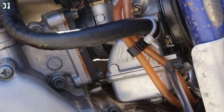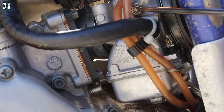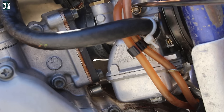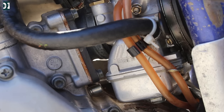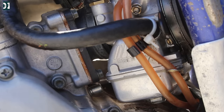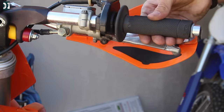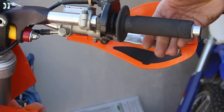On the YZ125, right here is your air screw, and this is your idle adjustment. You need to loosen this nut first, then with a Phillips screwdriver you can move it in and out — it's a very fine thread, so it makes small adjustments to your slider. I wouldn't bring it all the way up; just really small adjustments. The majority of the work is done with the air screw. Let me show you the throttle response and also that I have a little bit of play in the beginning — when I move my throttle slightly, the RPM is not changing.